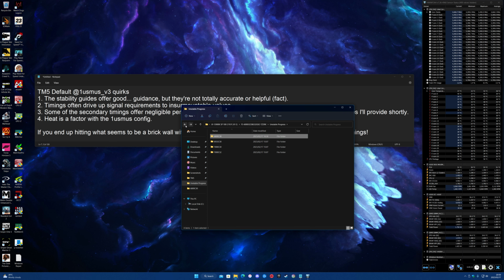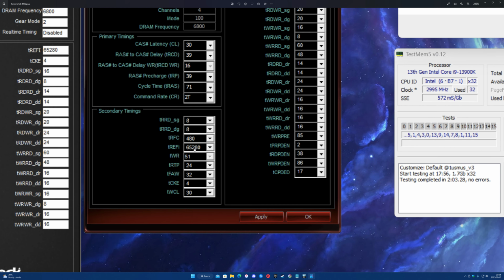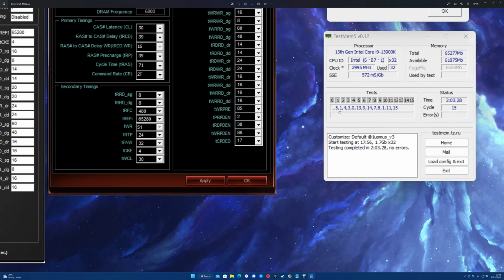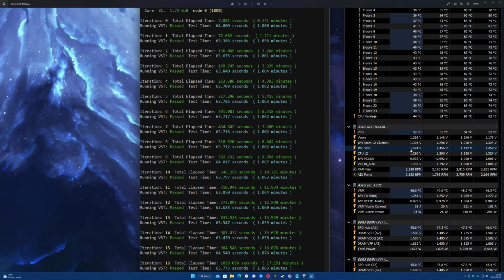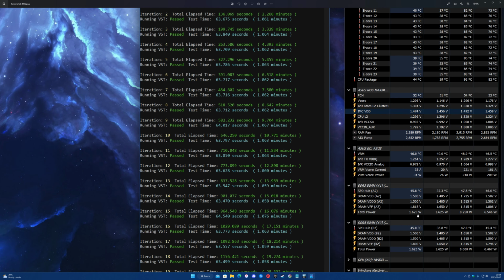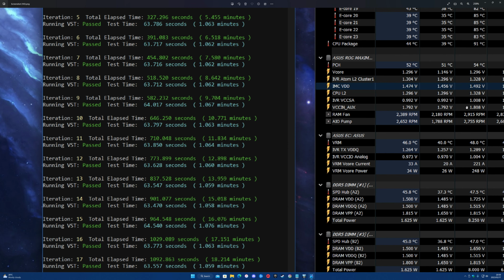Yeah, so basically, if you notice the side-by-side, not this, man. What am I doing? Yeah, the main determinants were this came down a lot. This went up. This went up. This went up. This went up. And these two went up very negligibly, like very slightly. And this went up. And then besides that, in terms of just voltage increases, nothing in terms of IMC VDD. No, kept it at 1.5, left it. Was it VDIMM, like DRAM voltages? No, neither. No point. TX came down by 100 millivolts. SA came down by 350 millivolts.